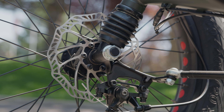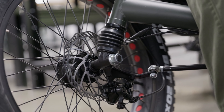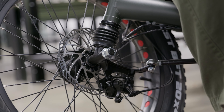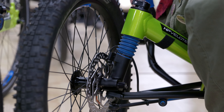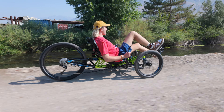The last suspension type is pretty broad, but all of these options are so unique that it's hard to fit them into their own group. What they all have in common is that they are all front suspension. First in this category is the front suspension on the Fat Tad CXS — a standard spring suspension, but what makes it unique is that it is fully integrated into the front spindles. It's notoriously difficult to get front spring suspension on a trike, so having this integrated is perfect for the off-road rider who needs suspension travel all around. Next is the front suspension on the HP Scorpion. On the Scorpion, you won't just find rubber elastomers, but also springs integrated into the front spindles. The HP Scorpion uses both types of suspension to give you great vibration absorption to prevent riding fatigue and great front suspension travel all at the same time.